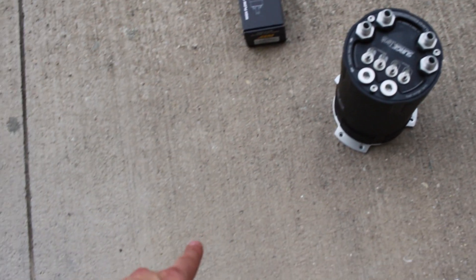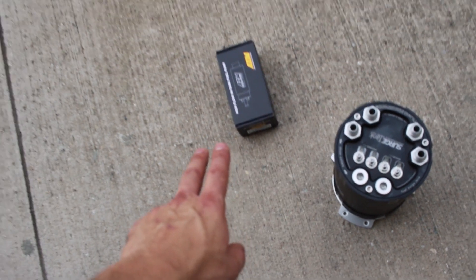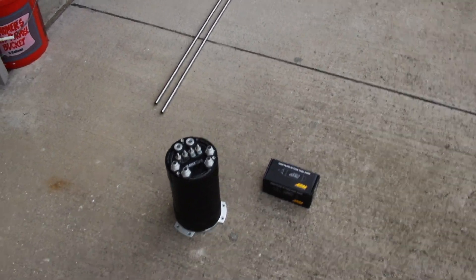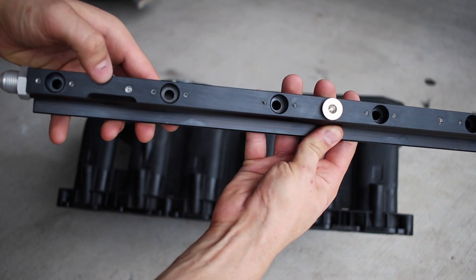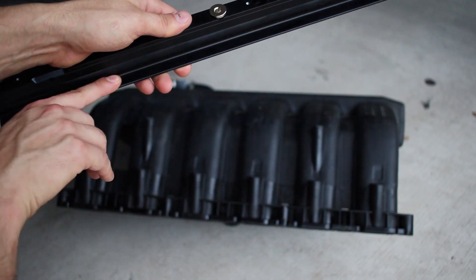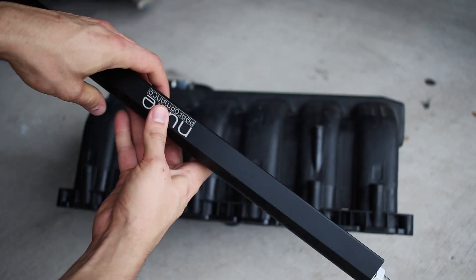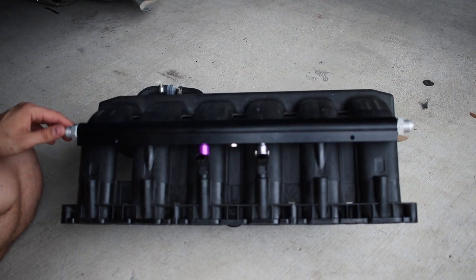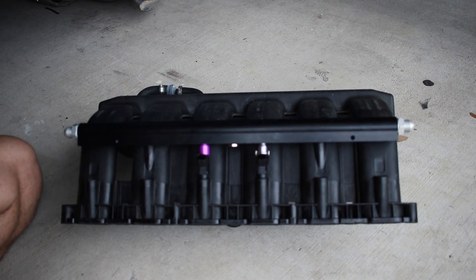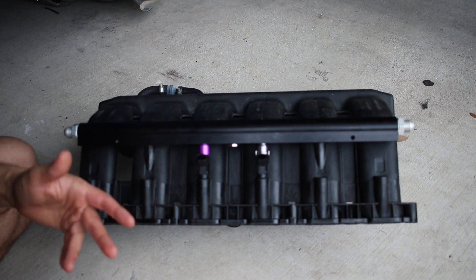The feed comes from the surge tank that we put together earlier. One of these lines goes from the surge tank to the feed line, all the way up to the rail, and the surge tank will be fed by the AEM fuel pump in the tank. Here's a closer look at that fuel rail — the brackets just attach here and here. It looks like a channel for maybe putting your wiring in there, which is quite handy. Super high quality CNC'd, comes with fittings. The first thing we'll have to do is change all the wiring so that the clips for these injectors go to the wiring harness of the stock S52 harness.